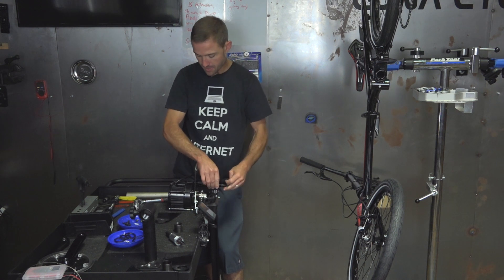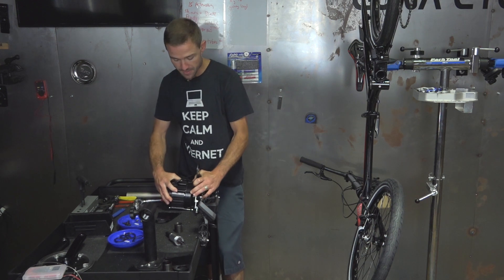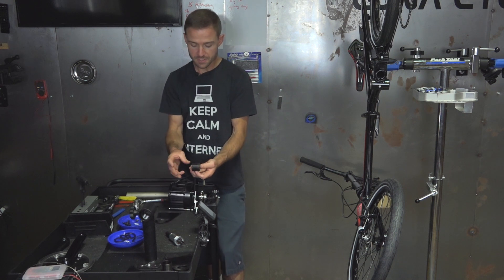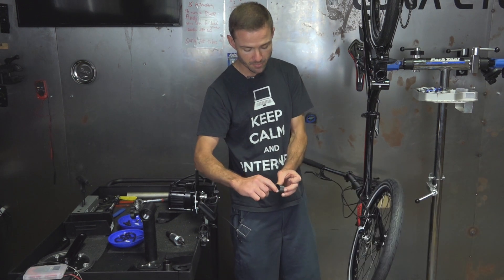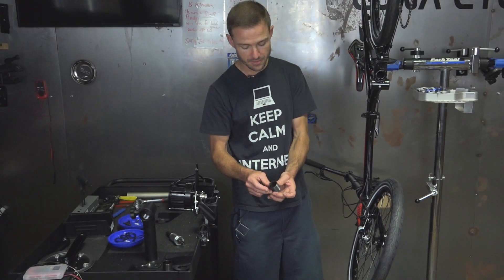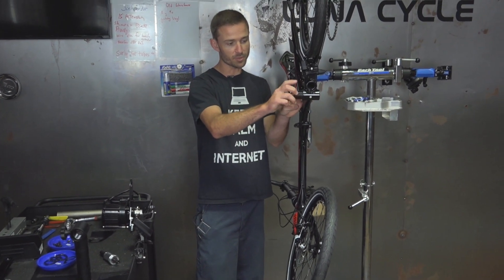I'm not going to get too crazy about it, because you're probably going to want to adjust that chain tensioner later. So the next step is you've got this threaded spacer adapter that goes on the non-drive side, and on the inside of it, on one side, there's a taper — you can kind of see it's a lighter color in there. You want to make sure that that lighter color goes towards the inside. Then you're going to thread this into the bottom bracket.